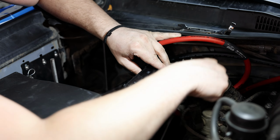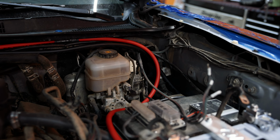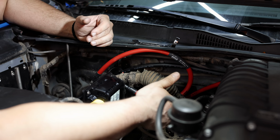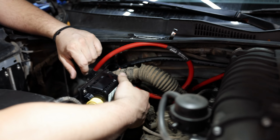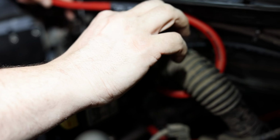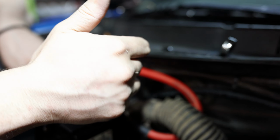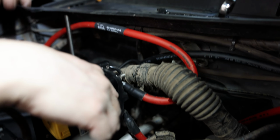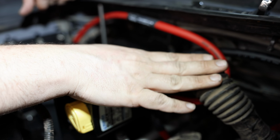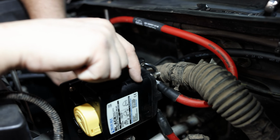Before we drop the battery in here, we're routing the main power cable from that side, disconnected, obviously. So we have that power cable disconnected over there, but routing it over, running it into the terminal on the bottom of the MLACR. And then we have the second cable, the shorter one, routing out of that. We're gonna be cutting some zip ties on this back harness and zip tying everything back up there once we're done running all the cables and getting everything mounted. But for now, getting the cables mounted to this guy, pre-running the cables from the other side, and then we're gonna drop the battery in and get everything connected.